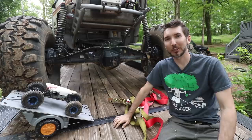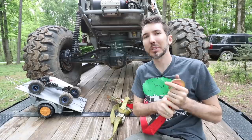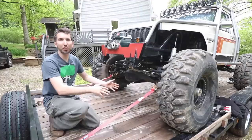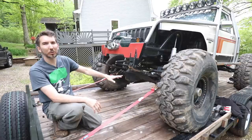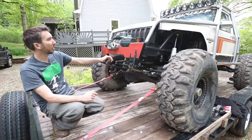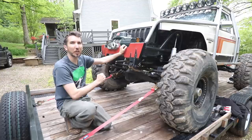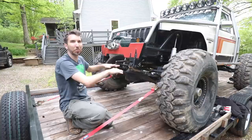Not only that, it doesn't matter what you're towing — even if it's just some cargo on your trailer, you don't want it coming off and injuring another person at 70 miles an hour. Anything coming off your trailer can be deadly. A lot of people ask: should I tie down to the axle or to the body? Now I recommend to the axle first. The problem with securing to the body or frame only is you're pulling down the suspension — wearing it out — and every time you hit a bump, it's going BAM BAM, putting a lot of wear and tear on the hook and strap.